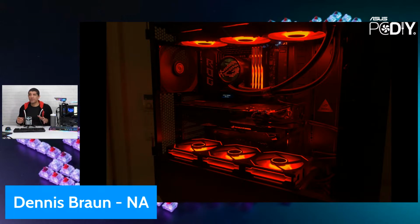But with laptops, critically, because they're generally not designed for so much performance variability, you would ideally want to match not only the frequency, but ideally the timings. If not, generally the default rules in terms of how the firmware will work for the motherboard, it will go to the lowest common denominator. So whatever is kind of the slowest configuration is what the other DIMMs would run at.